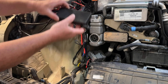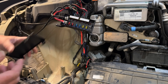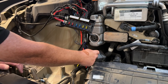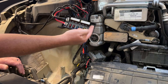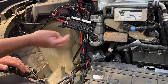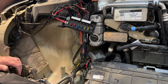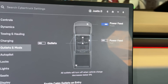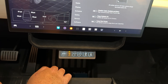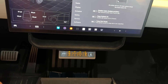From there we have this junction box, which powers all the accessories via the wireless switches I have inside the cab. Power runs to the regulator, which steps 48 volts down to 12, and that feeds the junction box, which separates power into up to six individual feeds. From inside the cab I can select which accessory I want on — so rather than all lights coming on at once, I can turn individual ones on or off without killing the main power.